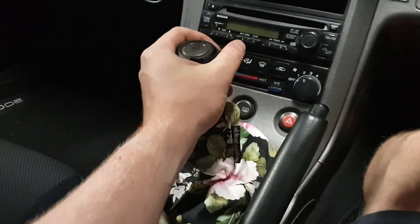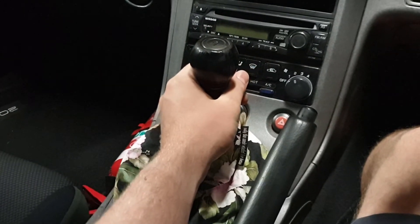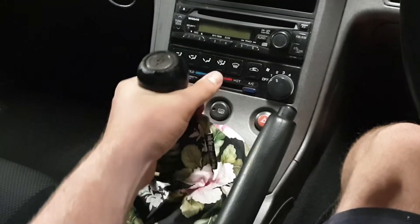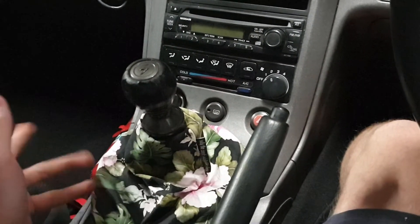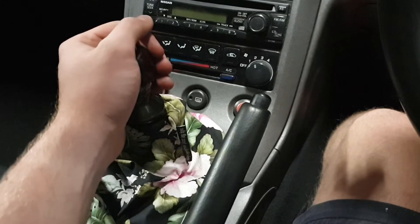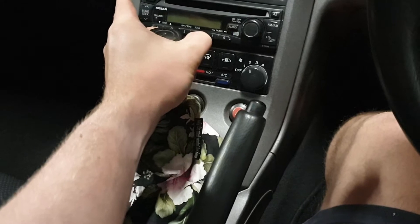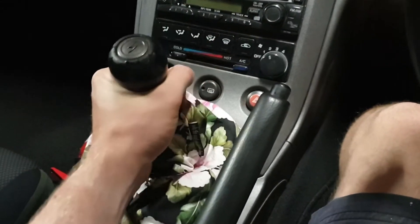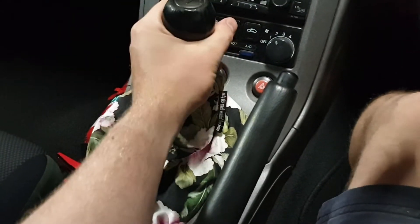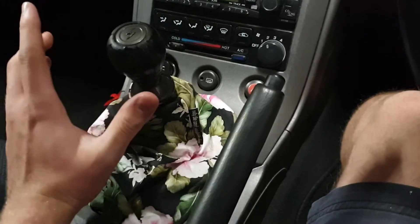They did a trick for touge where he goes third, then into the position where fifth used to be, and now fifth is a gear in between third and fourth. I'm going to coin this as the poor man's close ratio. They're happy with one, two, three, but they want something in between three and four, so they replace fifth because they don't need it for touge — the short circuit. Then you go third, fifth — or what they call three and a half — and fourth.